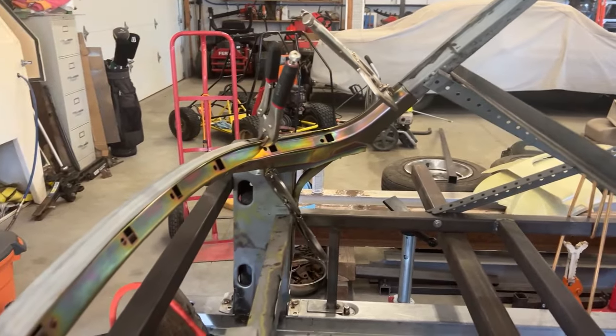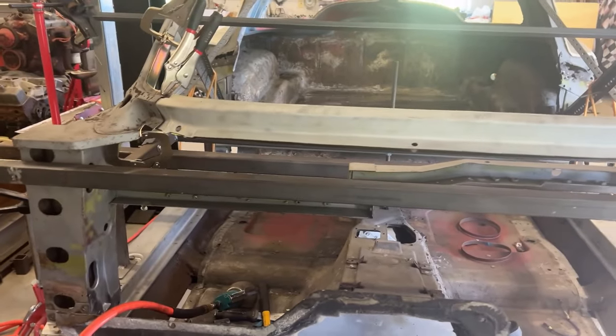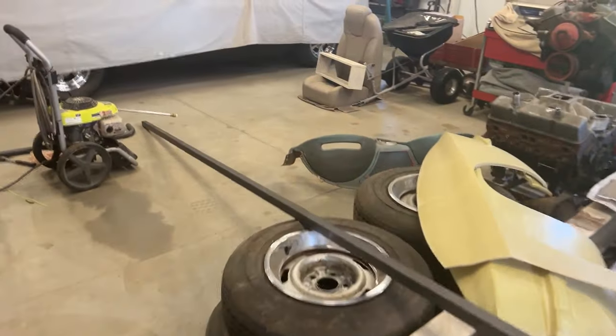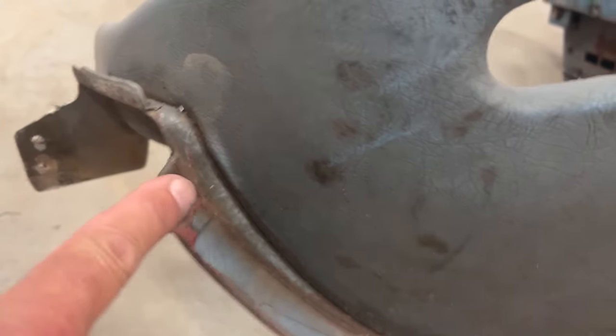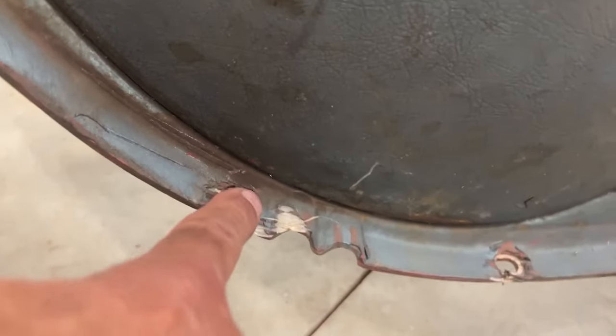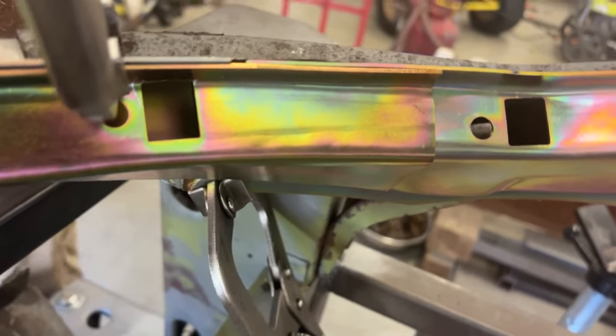Good morning everybody. I've got everything pretty accurately fitted up. What I'm going to do is some measuring to make sure I have the inner panel and the outer panel spaced correctly right to left. I'm going to do that by measuring the holes on the dash from the first to second hole — this dash has to bolt in, and the bolt positions are on different pieces of the window frame. If I measure center to center and get those right, I should be pretty accurate.